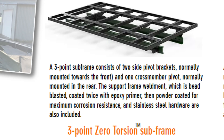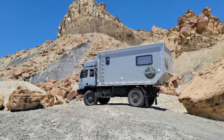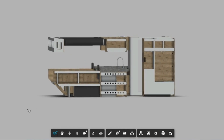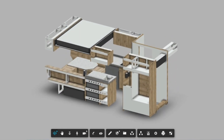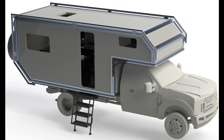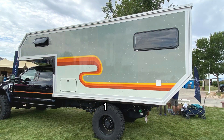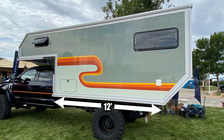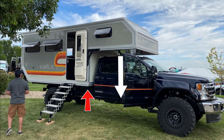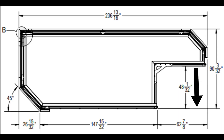The 3-point subframe system is designed for subframes 14 feet and shorter, which will accommodate up to a 16-foot departure angle habitat. It really comes down to how many pinpointed loading points you have versus how much weight you can theoretically carry. The larger the habitat, the more pinpointed loading points you should have. For example, the 19-foot Pathfinder cabover has a 14-foot departure angle main body — the base. That means the floor is 12 feet and so is the subframe, which fits easily into the 14-foot maximum for a 3-point. However, due to the cabover cantilevering a lot of weight over the front of the subframe, a 4-point subframe is used in this application. So cantilevering weight also plays a factor.